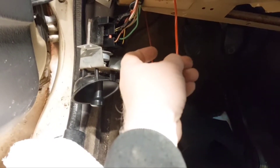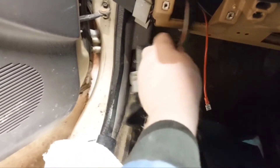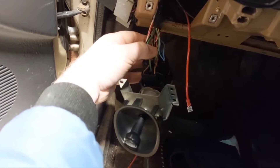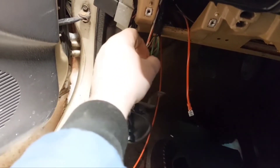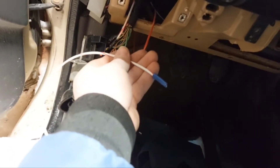Right now I've got the wires that are going to the little ignition switch tucked all the way behind and underneath the carpet, and they come up here. The red with white stripe is going to feed the switch — I chose that one because it's shorter, which is fine. I'm going to steal power from the headlight switch, because the headlight switch has a couple of thick power wires that carry plenty of juice. Like I said, we're not really carrying much load here anyway — this wire gauge is overkill.